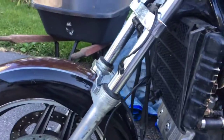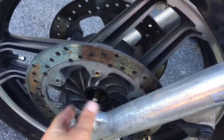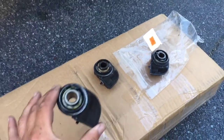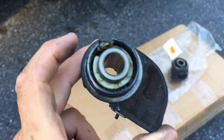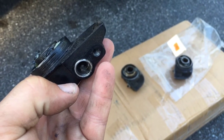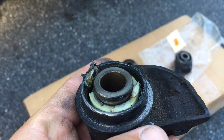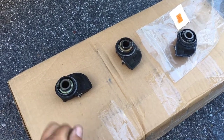I replaced the cable and then it didn't register at all. So the next thing to check is the actual gear that locks in here and turns. For 84-85 Sabers, we have this little gear in here — this is the one that came off my wrecked bike. This little plastic part spins inside and that's how you get your speedo reading. The line attaches in there, turns, and electronically broadcasts up to your speedometer. As you can see, it must have been jarred in the accident and that little piece broke off.